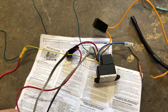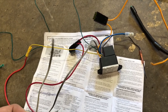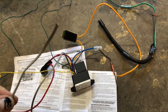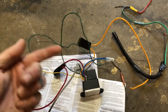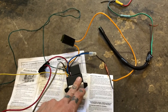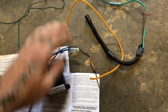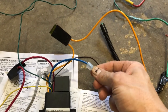The switch on the control box has two wires — one wire connects to each side of the thermostat temp switch, and this tells the box whether the temp is above or below 190 degrees. The green wire connects to the AC clutch signal, so whenever I turn on the onboard air and the AC clutch is requested, this also gets power, clicks the relay, and turns on the fan regardless of temperature. They included fuses for both the primary circuit and a secondary fan output if you want to run two fans.